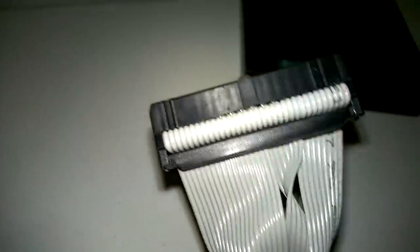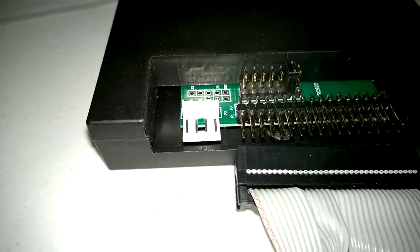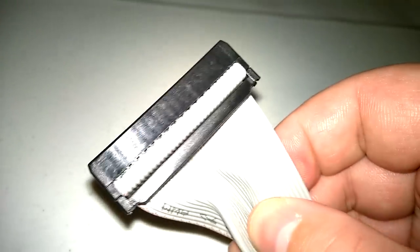So here we have a floppy cable. This one has a twisted part that goes with the floppy drive, and the red bit goes here. So red goes with pin 1 and the twisted part goes with the floppy drive, whereas see there's no twist on here. This goes into the motherboard, and same with the motherboard, look for pin 1 or 2 for the red marked cable.